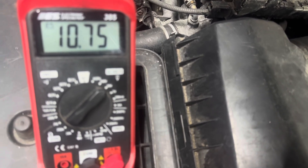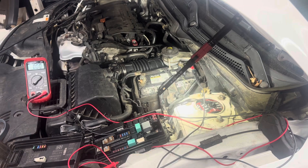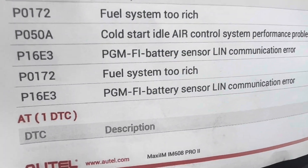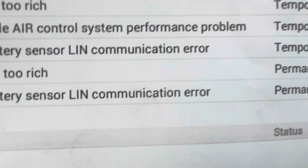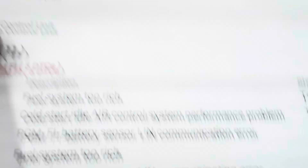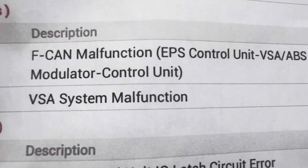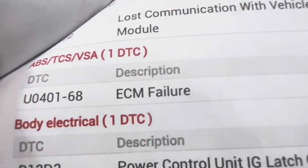Now I'm going to start this car. One of the codes that you're getting is P16E3. Let me show you what codes I'm also getting. You see here at the bottom — it's a P16E3 in the engine computer, FI battery sensor line communication error. It could be the line getting disturbed by ABS, because in here there's an ABS problem. You also see EPS code, F-CAN, modulator control unit, and VS malfunction. When we go up in the ABS, you also see ABS malfunction.